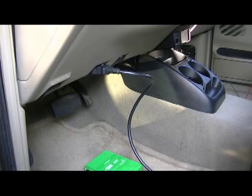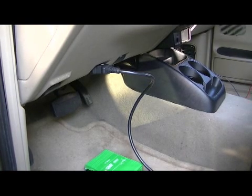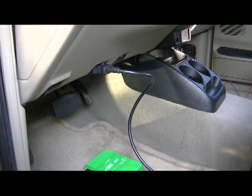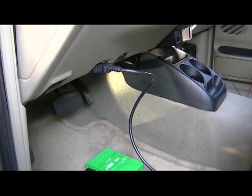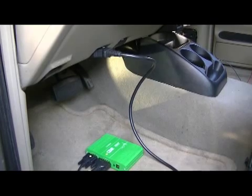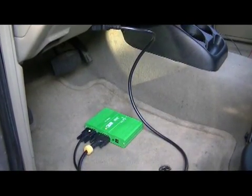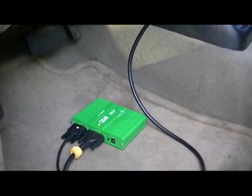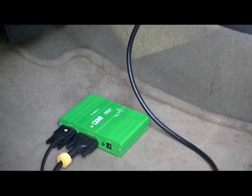Now let's assume the vehicle has a dead battery — perhaps it has an electrical system that is not intact or is potentially dangerous and you do not want to risk attaching a booster pack to the vehicle. At this point, I have already identified the ACM fuse and appropriately connected the repowering rig. I have also connected the CDR interface module to the DLC with the DLC cable. However, in this case, you can see that the green light on the CDR interface module is not illuminated. It is because we have no in-car power, but this could also be the case if I had disconnected the vehicle's battery for safety reasons.